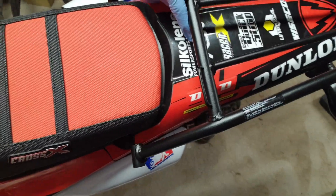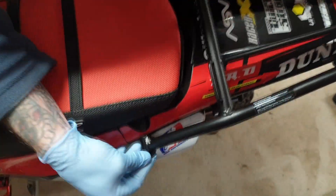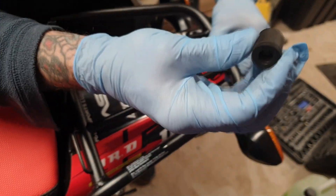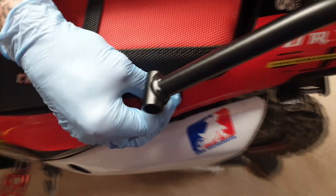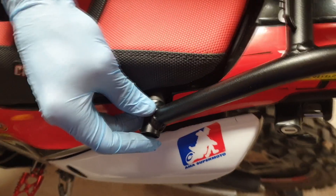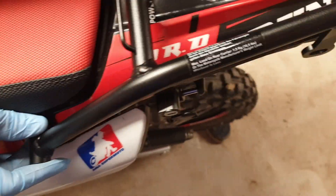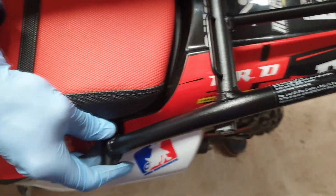Okay, first job is to just roughly put the rack in position. As you can see you've got the spacers and a bit of space where the actual mounting bolts are — that is where these spacers come into play. The larger ones are going to go snug into the actual panelwork. This then goes in front with the extra long bolt through there. The shorter bolts at the back are roughly the same except they have a washer in place, which I'll show you in one second.